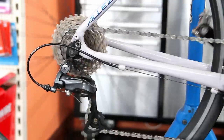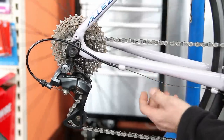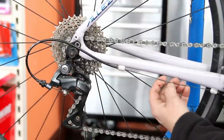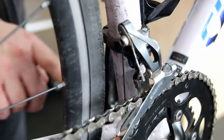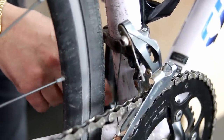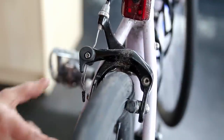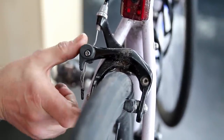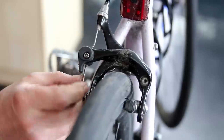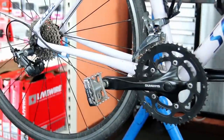This bike is actually in quite poor condition - although it looks nice, there was a lot wrong with it. Initially it's not changing to the smallest ring on the rear cassette; the cable is dropping slack and yet it's not dropping down into that final cog. I've got to figure out whether it's the cable or the derailleur itself. The front derailleur was completely seized - you can see when I drop into the small ring the cable drops completely slack and it's going nowhere, so the component itself is completely seized up. The back brake was hanging - you could pull it but it wasn't releasing, and the cable is completely frayed, which becomes a safety concern.